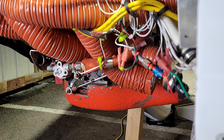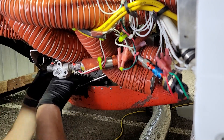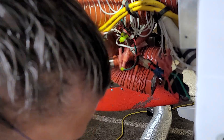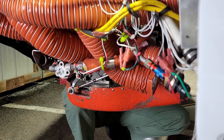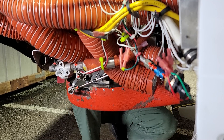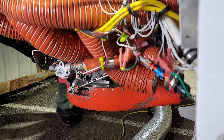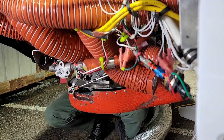I'm removing the airbox because I needed access to run the new scat tubing that you see I've put above — that's coming in another video. When I did so, I found a couple of problems. This airbox is a Vans FAB, or fabricated airbox. It's meant for a Vans RV airplane, and it is a pressure recovery airbox. I take ram air from the NACA duct, it goes into the front, there is a K&N filter in the center. It's basically made of fiberglass with an aluminum top.